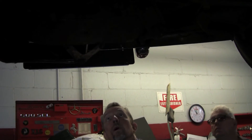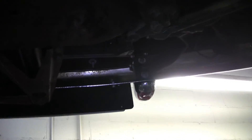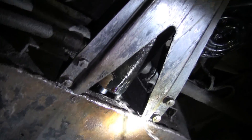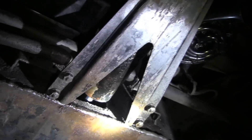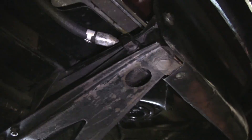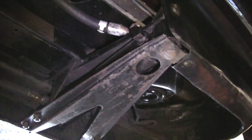And here is what we're going to fix on this car today. Up front, you can see this car sat here maybe an hour or so, and there's a drip right here that was not there before. It's power steering fluid or transmission fluid — they're the same kind of fluid. You can see it dripping right from there, and that is the ram which does the pushing.